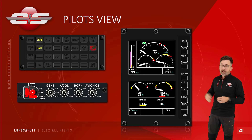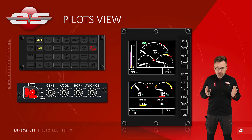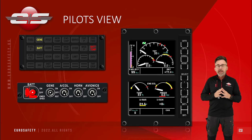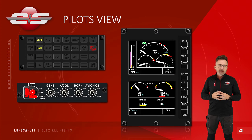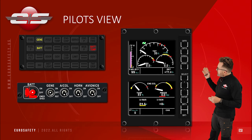The battery light is the same thing. The battery light is not connected to the battery whatsoever. It's a relay position indicator, so it tells you whether the battery relay is open or closed. If the light's on, the relay is open. This may seem like a minor distinction, but it's important when we analyze failures within our helicopter.